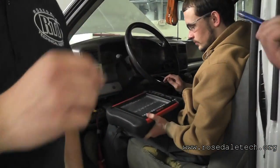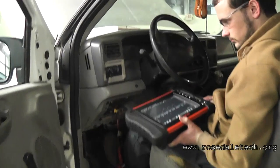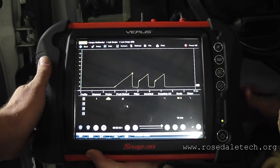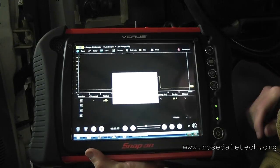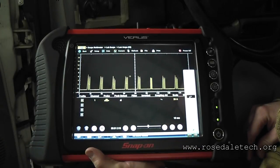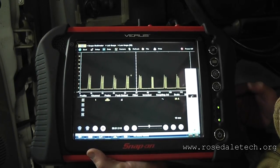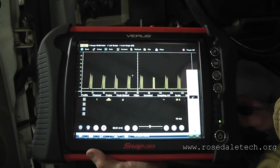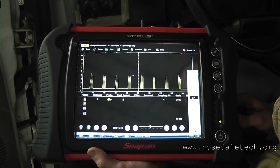We were admiring the home-done wiring. You got me a waveform? No, we haven't zoomed out yet, but I figured if you wanted to see that, we would do the zoom. Let's see if we can get this. So the first — this is a good capture. You froze that, right? Then you hit this button and we'll zoom out on that buffer. Then what we want to do is zoom in at different levels and look at them. I see a problem already. This is a V8 engine, and they multi-strike fire the coils at low speed, so the reason we see groups of three ramps instead of one is each coil is firing three times. What we're looking at is all eight on the screen — one through eight.